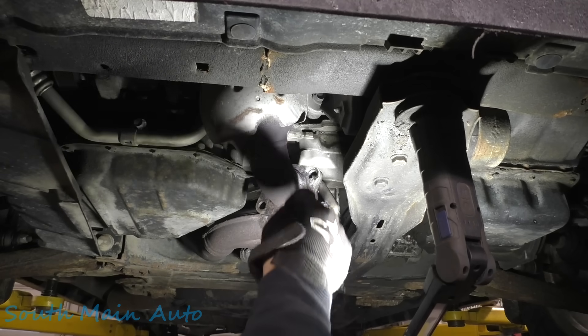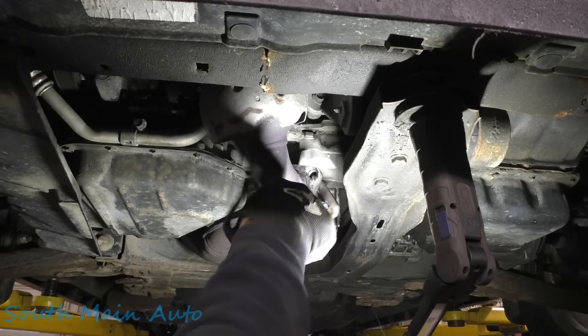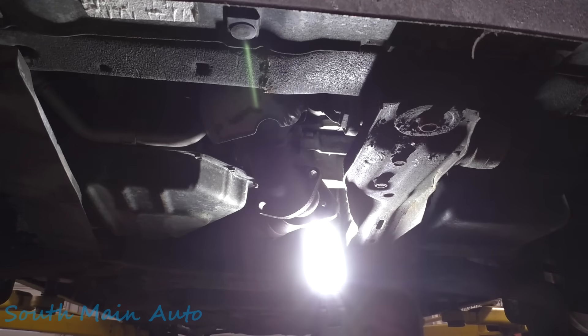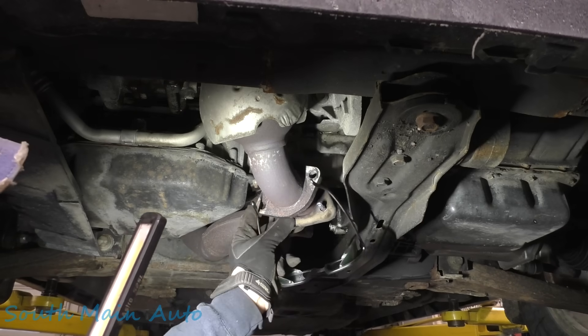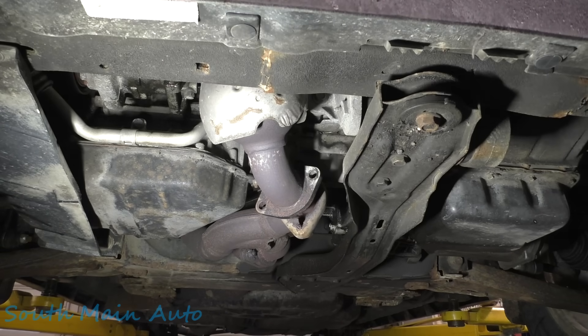Wait, people don't think I've burned the pipe off - that's all good. I think we can just cut those nuts off the back. Usually there's just a couple little tiny spot welds that hold those on, so we'll go on the back side, spin them down, and nick those babies off.